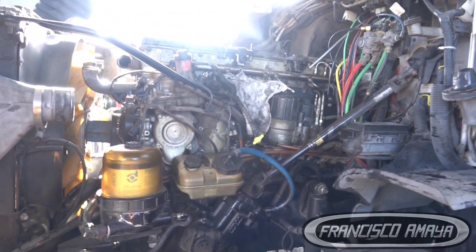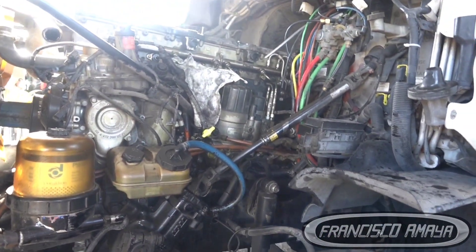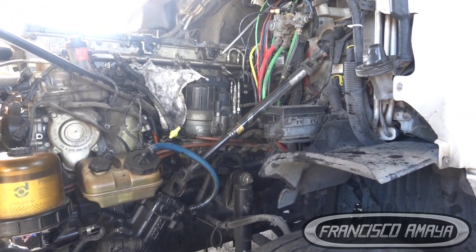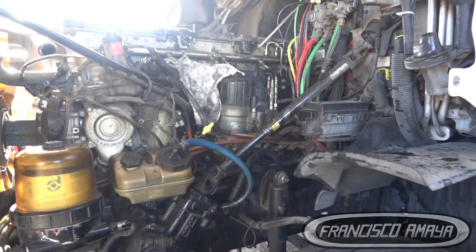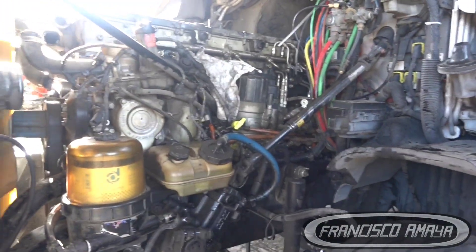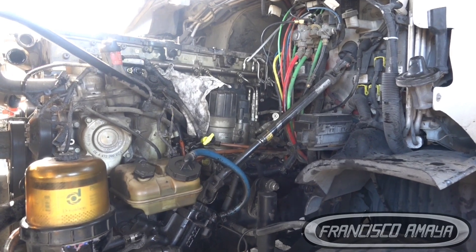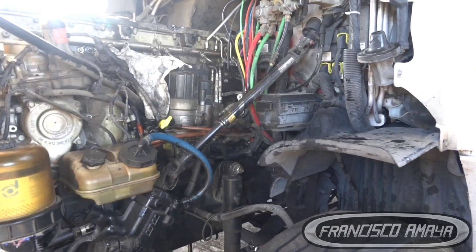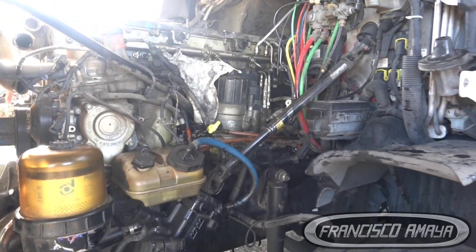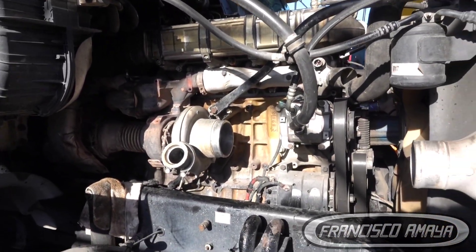This is what I wanted to share — the problem with this DD15 engine. If you happen to have a DD15 engine with a broken cylinder, whether it's cylinder one, two, three, or four, you do have the option to replace just the broken cylinder. But be aware that any other cylinder could present damage. If another cylinder breaks right after you replace just the one, that is on you — that is not the mechanic's fault, especially if you asked for it. Preventing problems is very important, especially knowing how expensive it is to repair these trucks on the road or even just to tow them.